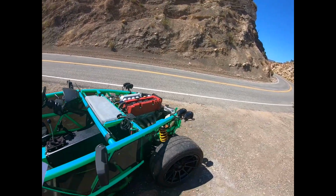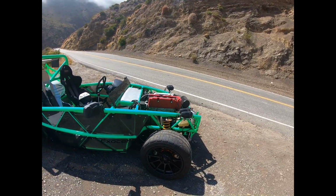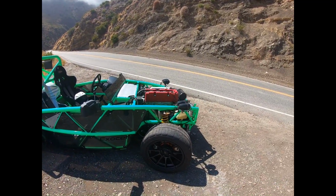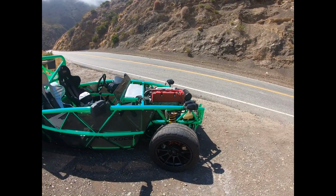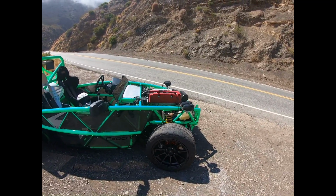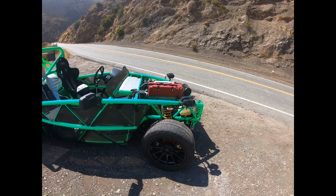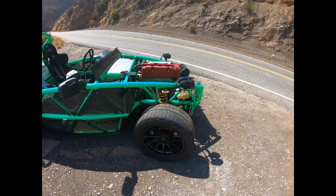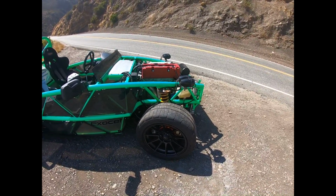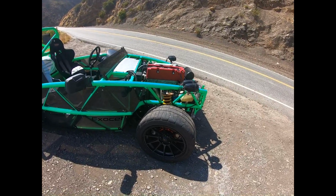So next thing is the wheels and studs. These wheels I got from Goodwin Racing. I was looking at getting some Volk TE37s, but they're very expensive, and there's a many-month wait on those. So these are the Advanti Racing Storm S1s. They're 15x8 plus 25s, and believe it or not, I didn't measure them, but they're 11 pounds. So at $170 something per wheel for the 15x8s, I think that's a great deal.